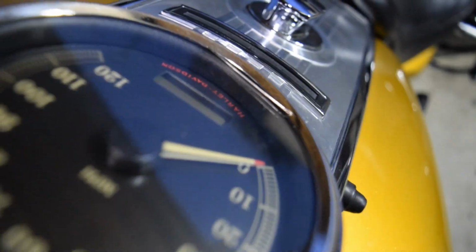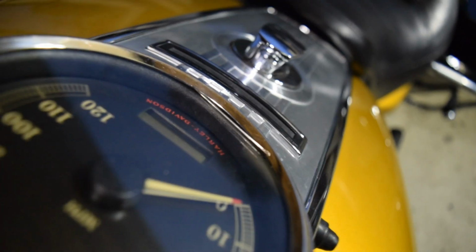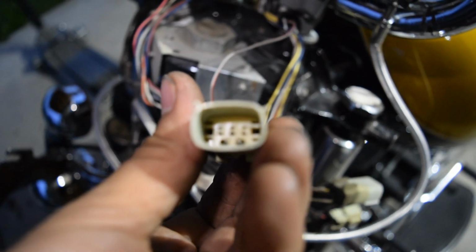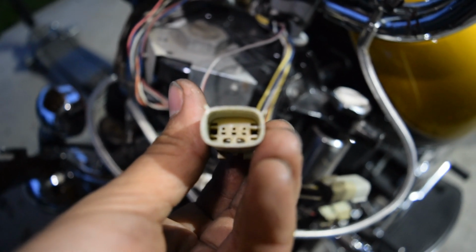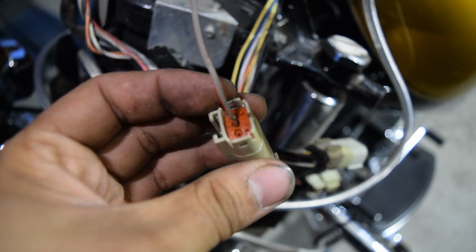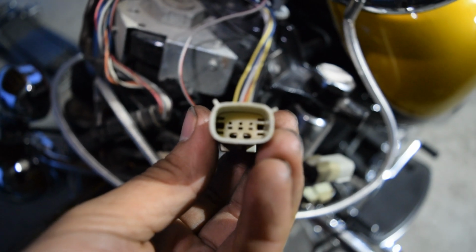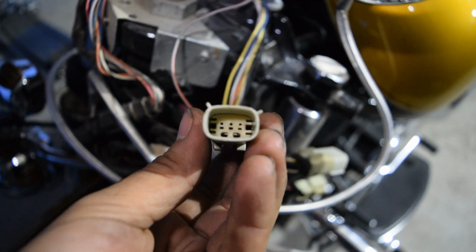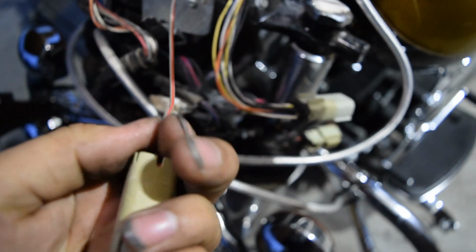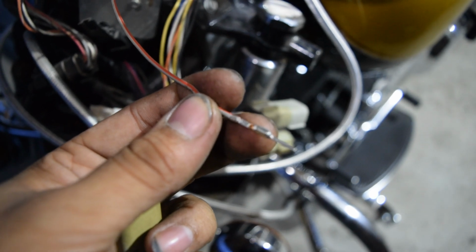And then right here I'm just using a needle, and inside the pin there's normally a connector that comes out, right? And it's right in that very center hole where the wire is, as you can see right here. So essentially the little tiny hole that's above it, you just insert your pin or your needle or whatever, and you wiggle it around, and the wire itself will come out, boys. So let me see if I can take this one off for you guys. So there it is.